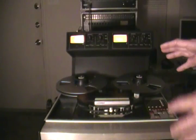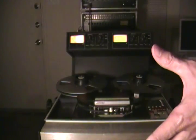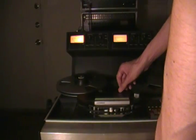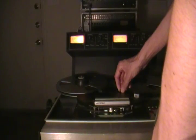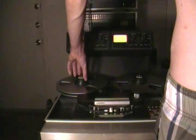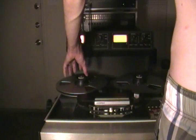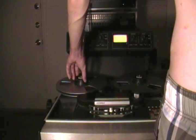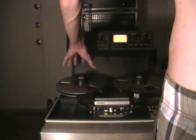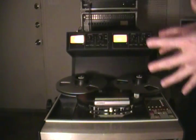Here's the trick that nobody seems to know about this machine — if you don't know this, you'll never even get it to roll tape. You've got to hold down the stop button. Let's say you're locked in at 15 IPS. Hold down the stop button, and with your reels, what you do is you just turn it tight, basically — very lightly — and then the caps, the reel hold-downs, they lock in.